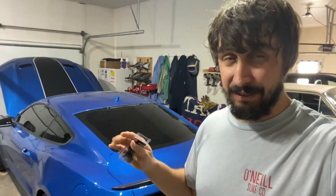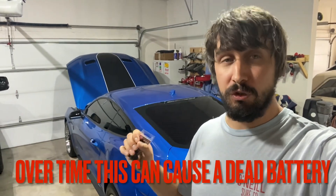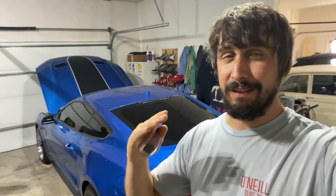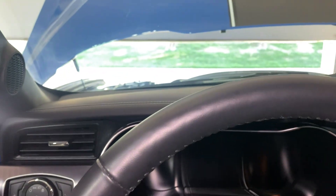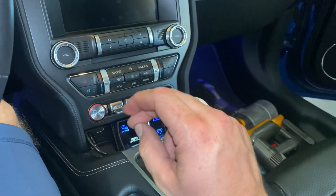The problem is on an older car like my 64 Mercury, it's very easy to find a switched 12-volt source — when the key is on you have 12 volts, when the key is off it's off. On modern cars like this one, turning the key off or pressing the off button doesn't necessarily turn the car fully off immediately. So with my boost controller, I thought I was on a switched 12-volt source and it sort of is, but when you turn the key off, power remains for a little bit. The boost controller starts working right at the point between vacuum and boost, which is ambient pressure. What pressure is in the intake manifold when the engine's off? Ambient. So when you turn the car off, you will hear clicking from the boost solenoid, and over time that will drain your battery.